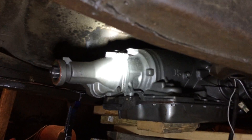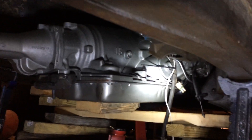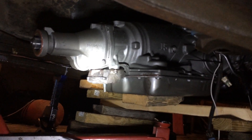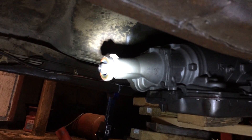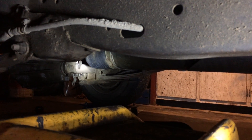We've just got two bolts in here right now, but that's enough for today. The next thing I'm going to do is put the crossmember in, and I'm going to make sure that the tail shaft — or the output shaft — is in a straight line with the differential. I want to make sure it's absolutely perfect going back together.